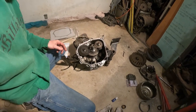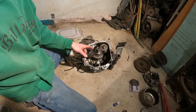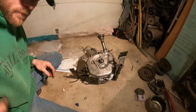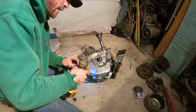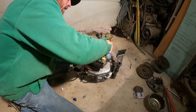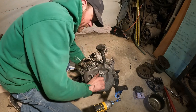Let me get this gasket going here. This is pretty simple. Clean it up good with Scotch-Brite before you put it together. And then oil your spots again before you put this in. This way everything's nicely oiled. Okay, when you put the cover on, put a little Loctite on it. And then just kind of suck them down quick. Not really all the way down. Just in the pattern here. Make sure everything's good. Put a couple down and tight.